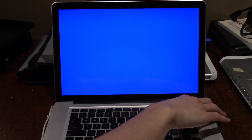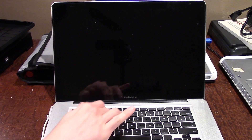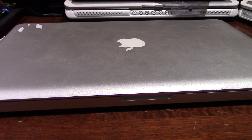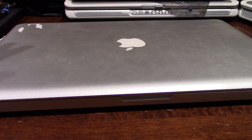I'm going to try a clean install onto this hard drive. We've been stuck at this screen for a while, so I think I'm just going to boot into Internet Recovery — that's our last option — using Command-Option-R. We should automatically boot into Internet Recovery mode. Welcome back, guys. I might have spoken too soon about this laptop being in working order, because as it turns out there is a more severe issue, which was also pointed out to me on the original video. Apparently these 2011 MacBook Pros are notorious for having an issue with the onboard graphics chip.